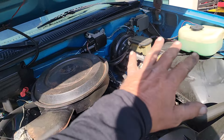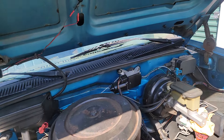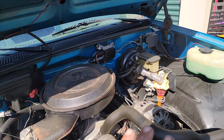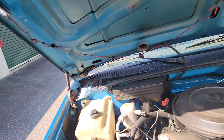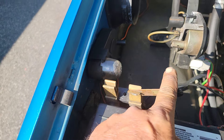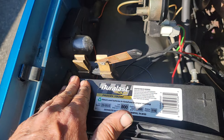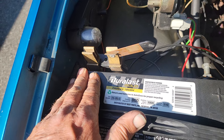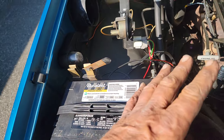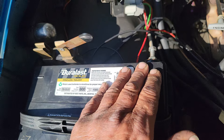My wiring harness does need some attention, but if anything on this truck starts smoking electrically, all I've got to do is lift the hood. This is called a knife switch — it's on the negative side of my battery. When you disconnect the ground, instantaneously all this potential is gone because it has nowhere to go.